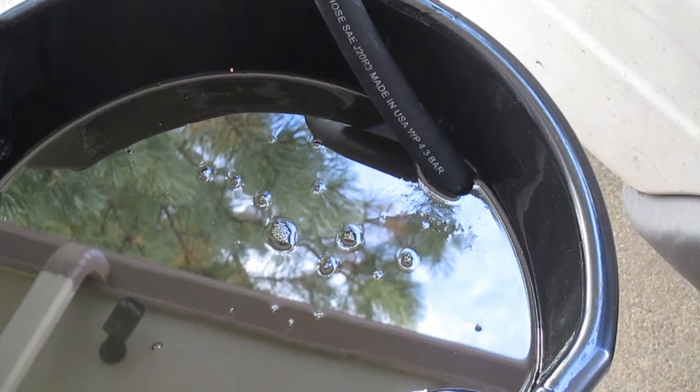Now we'll do the return hose side, and this is the orange one that I got with my kit, 91345-RDA-A01. And that fits nicely on there. Got our hose in place already, and the bolt that we've had to fish out from a cavity down there twice now. So let's see what we can do to get that bolt in there. There's really not much space to work with here at all. Oh, I'm gonna drop it again.